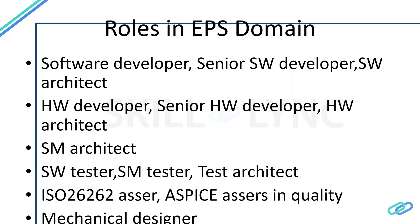System testers connect the ECU to a simulator, provide all simulation signals, and observe how the ECU behaves and evaluate the results. The test architect role, sitting on the right side of the V-model, takes care of the test system tool chains — deciding what tools to use, whether model-based testing or ECU tool-based testing — and handles all related tooling decisions.